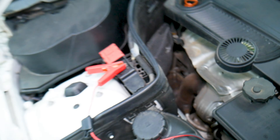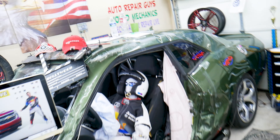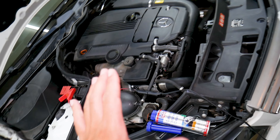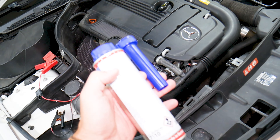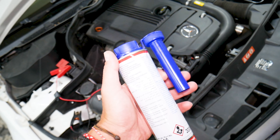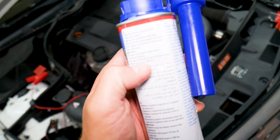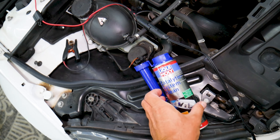What we'll usually do first is test the downstream oxygen sensor. If you don't know how to do that, we have videos on our YouTube channel that will teach you. Next, depending on your Mercedes and fuel tank capacity, don't add more than 70 liters of fuel — in the US that's about 17 to 18 gallons. The additive treats up to 70 liters and lasts 2,000 kilometers.